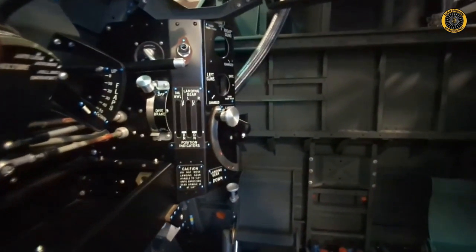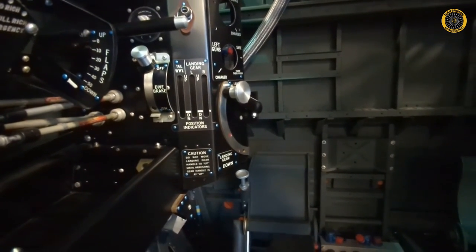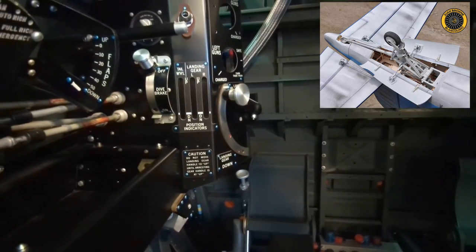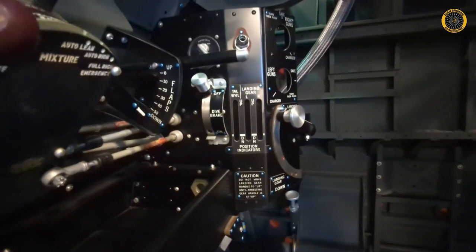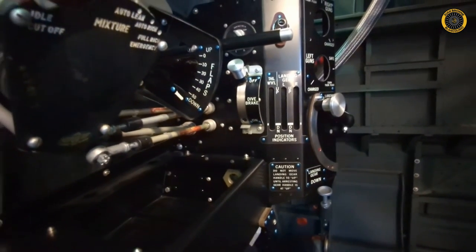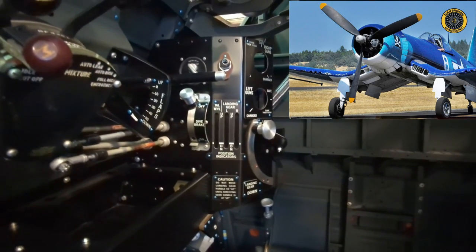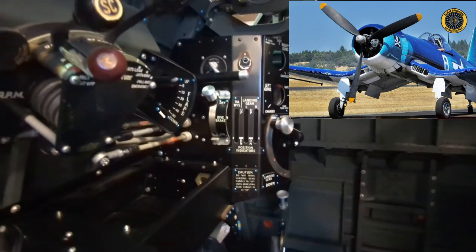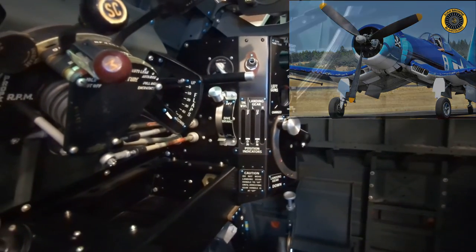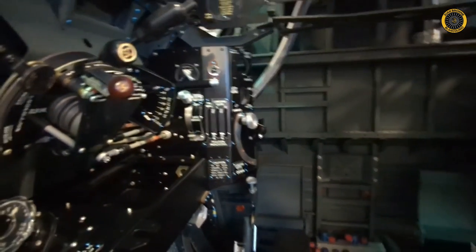Now let's go over this landing gear and dive brake system. There's the landing gear up-and-down knob — when you raise and lower the gear you get all three: the two main gear and the tail wheel. The tail wheel doors have a 200-knot limit as the limiting factor. The dive brake system is very interesting: to lower the dive brake for a dive bombing run you throw that switch, and the dive brake on the Corsair is the main landing gear itself. That big plate on the front of the gear — the main landing gear on the Corsair is so strong for carrier operations that you can lower the two main gear all the way up to Vne, the maximum speed of the aircraft. But you cannot lower the tail wheel at the same time, which is why they have a separate dive brake versus landing gear system.